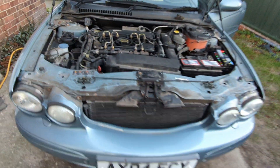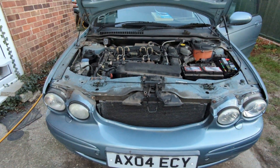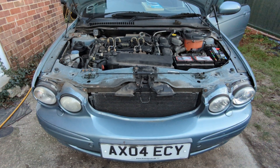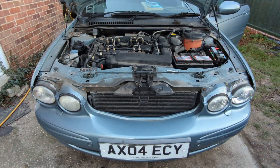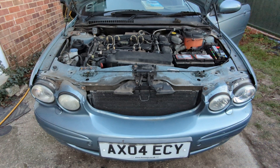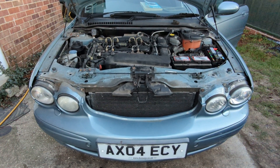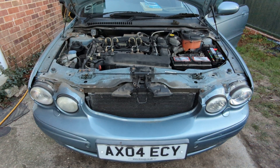The other big job I've done is I fixed the bonnet, which wasn't closing properly. A bit of research on various forums indicated that the problem was that it needed a new bonnet release cable, so that the latches were not relaxing when they were being closed and were not allowing the bonnet to slam down and remain shut.